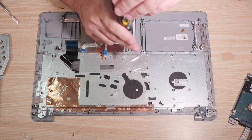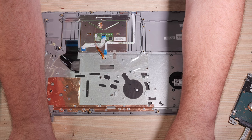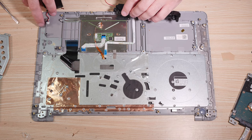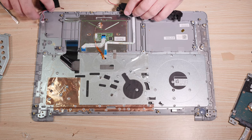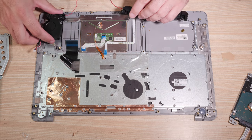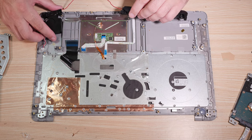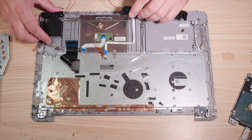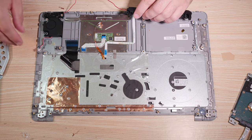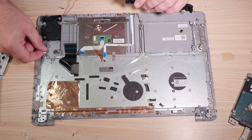Now the next item should be the speakers. This assembly here, and I remember I told you these are no fun to put back. So what I'm going to do is get this one speaker here, get it back on its mounting pegs. These big ugly round things here. Come on. It can be a bit of a pain, but there we go. Okay. All right, that speaker is mounted. Let's go ahead and get the main speaker wire that goes to the motherboard wired back up.